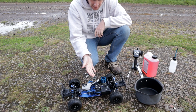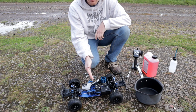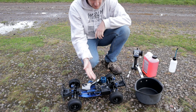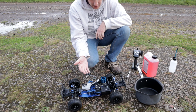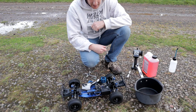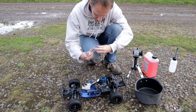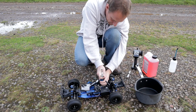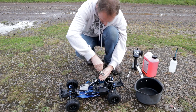Incidentally, the instruction manual said that out of the box the truck is configured for the run-in period. It's set to run rich to help the run-in period go well, to let it run in properly. It'll probably run lumpy until it's running, and then only after it's running do you then adjust the idle settings and everything. This is all me going by the instruction manual. So cool, we'll do that. First of all, I'll take the glow plug out. Oh jeez, there you are.